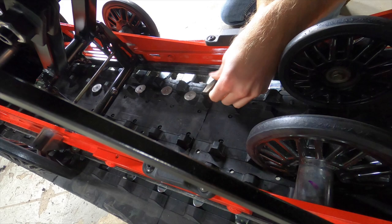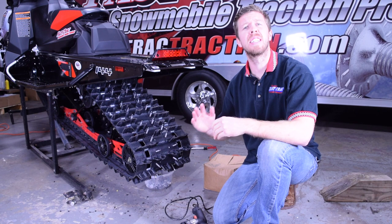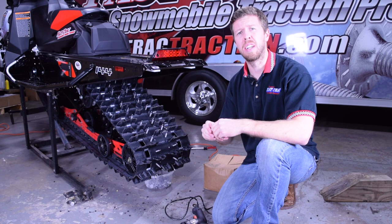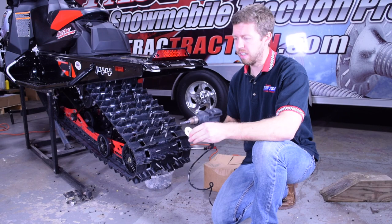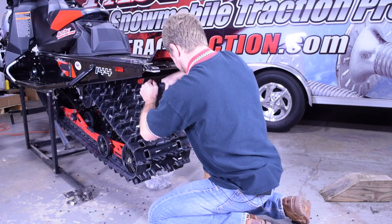In this section we're going to cover drilling the second hole for the double backer. If you're only using single backers, skip ahead to the tightening section. For those with a double backer, the second hole spacing is critical — there's very little tolerance for error, and too close or too far results in a crooked stud. That's why we recommend creating a jig using a spare double backer. Drill out one side to a 3/8-inch bit so the track cutting tool fits right through it. Place the undrilled side on the protruding stud, a little bit through the hole, and you get perfect spacing every time.